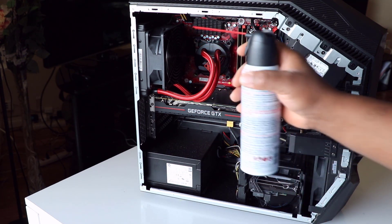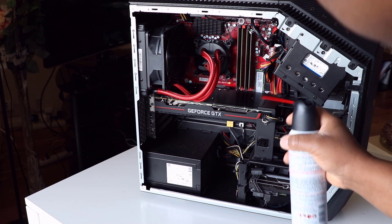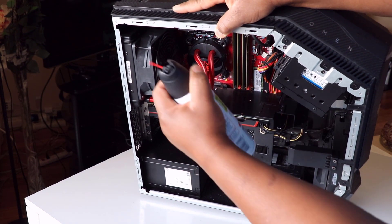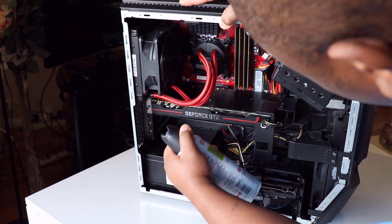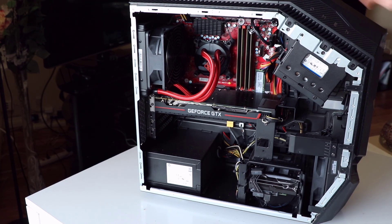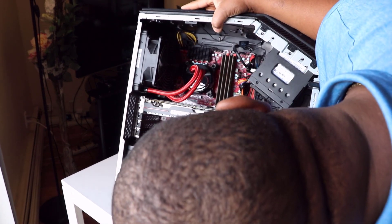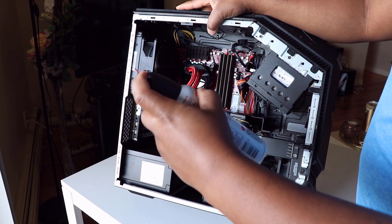The main purpose here is not to damage any electronic component — it is to remove the dust. So quickly spray everywhere and you will eventually see the dust coming out. If it's not coming out properly, you can try to tilt it a little bit. My GPU is here but the fans are facing down, so what I normally do is lift it up a little bit to get better access. One important thing: the can may have some liquid inside, so never shake it or turn it on its side — always keep it upright.